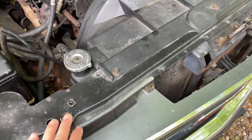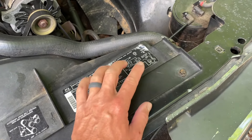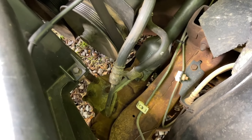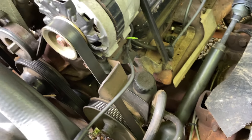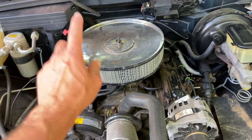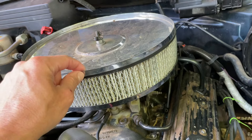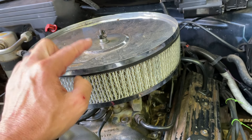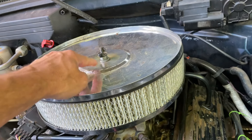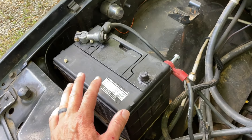The shroud is excellent, no cracks. A lot of times if these things have been worked on, they always over-tighten these and they would bust. This is a good vacuum tank. Look at that gearbox — I don't see a bunch of grease like it's leaking or anything. There's a little bit of coolant leak on the water neck. Looks like they took off that factory air box — I saw it in the bed. Comment down below if you know what's going on with this lid being upside down, but if you know about that, you'd know it does no good on one of these style air cleaners.